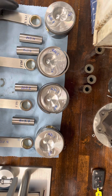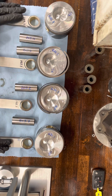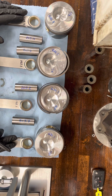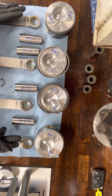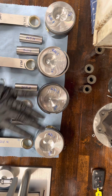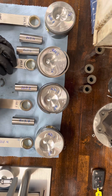Just try to get it as balanced as you can. It's all relative to what you're doing — if you're building a high RPM race car or dirt track car, this has to be a whole lot more critical. Remember, this is a diesel, so there's a fair bit of robustness to it. I did measure the OEM pistons and there were variations on the original pistons as well, so I know these things can run fine with some variation. Doing some rough math, it looks like I'm going to be able to get within a gram and a half rotationally to counter for this, so we should be in good shape.